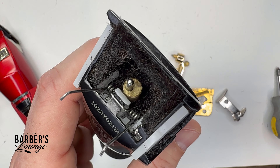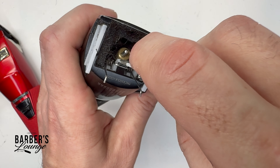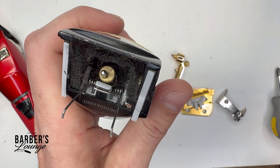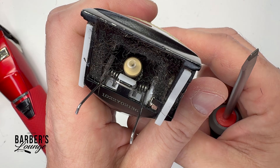So how did I fix it? What I did was put a flathead screwdriver in here, gripped it, and just bent it back a little bit. That gave me enough clearance so the motor could spin freely, and then it doesn't shut off anymore. Even after I took the blades off, it would still shut off — but bending that bracket back fixed it.